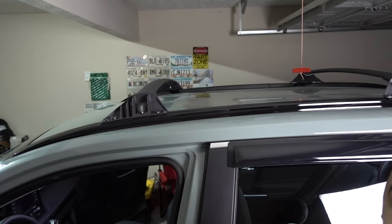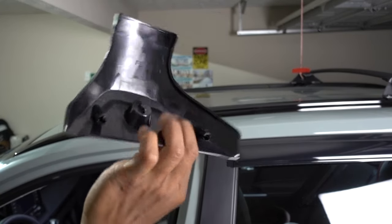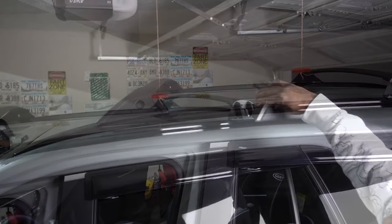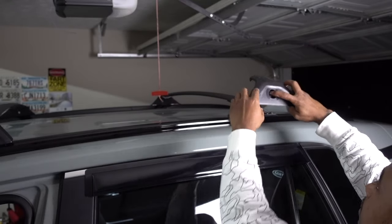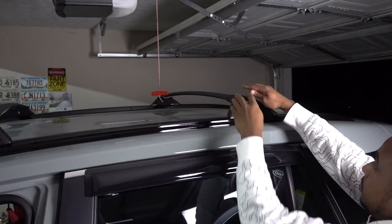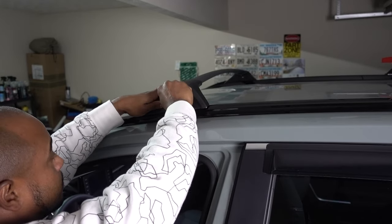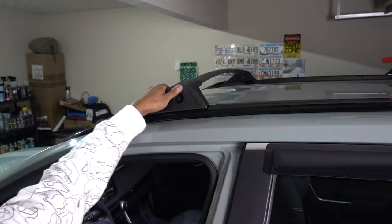Once you've got everything tied, now let's put the covers. Same thing with the covers — they're specific. They have arrows that show direction; it says 'forward.' This is the front left, it's going to be on the driver's side. This one says rear left, this is on the back. Once you have them ready, make sure that this is unlocked and straight. Push it down to lock it in place. Now that you have them in place, with the key, lock it. Turn it — it gets sideways, now it's locked in place and it doesn't go anywhere.